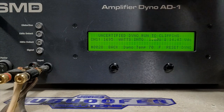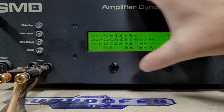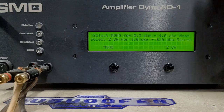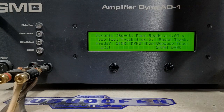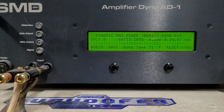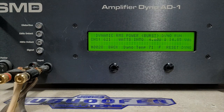Very impressive — these Damore amps, we're big fans. I'm a dealer for them and we love the installs with these. Continuing now to dynamic — burst test, 40 hertz pulse tone — starting with 4 ohms. Chargers are off; we're up to 14.97 volts now that it's rested. 4 ohm burst, rated 525 watts — well overrated: 621 watts into 4 ohms dropping to 14.85 volts, very solid.